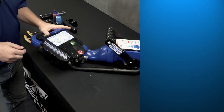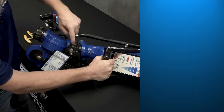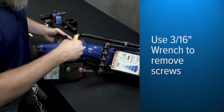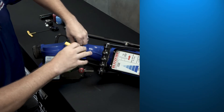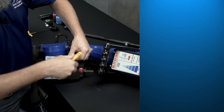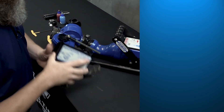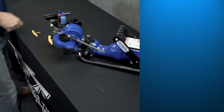Welcome back to the workbench, we'll tear into this. First thing we're going to do is get this big mechanism out of our way. In order to do that we're going to take these two screws out right here. To do that we'll need a 3/16 Allen wrench. Those do have red Loctite in them so at first they will take a little bit of force to break. Once you remove those you can set them aside — none of the parts we're taking off are going to get reused in the reinstallation in the new kit, so you can set those aside or dispose of them. If it doesn't just fall out on its own, go ahead and pull it off the oscillation shaft, which will remain in place, and set that aside.